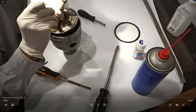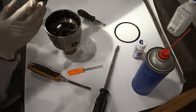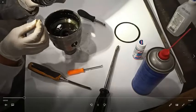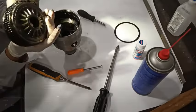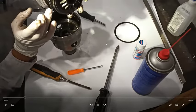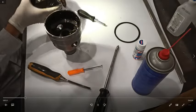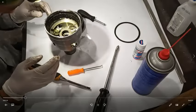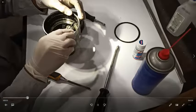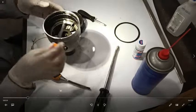My first impressions when removing this — compared to the original OEM failed condition — was that there needs to be more fluid in there. I used 45 to 50 milliliters before, but when I took it apart there were air bubbles, big air pockets. You don't want that; it needs to be totally full. So I used the whole container, which was 60 milliliters, just over two fluid ounces.